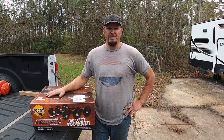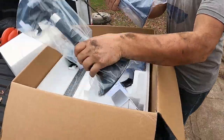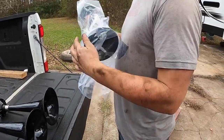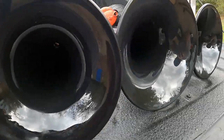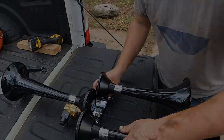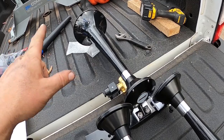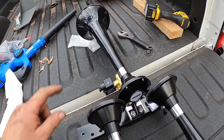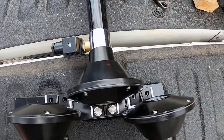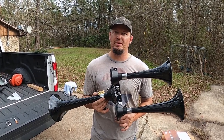It's time to install this train horn. We have a pretty good place to put it, but it's going to require us to modify the mounting brackets. Here is our modified air horn setup — normally all three face the same direction, but the spot we have doesn't have space for that, so we're going to face one backwards and two forwards. We'll mark the spot, drill some holes, and tap them so the bracket works. We have our bracket modified and our horns are test fit.